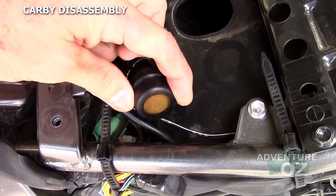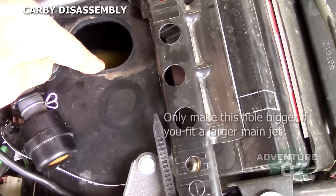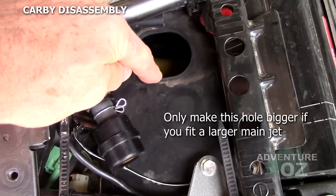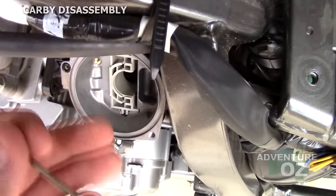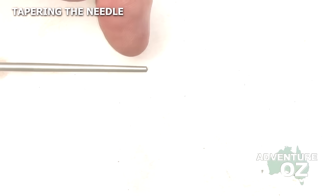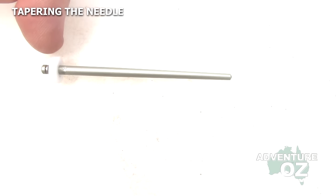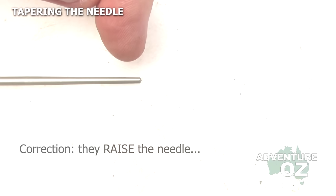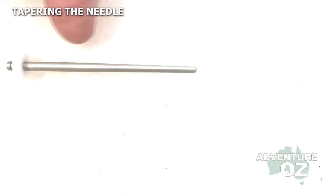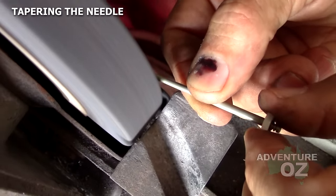If you taper the needle, what you can do is take your snorkel out but don't enlarge the air hole. You'll get increased air intake, but just enough to suit a tapered needle — assuming you don't change your main jet. The problem with the stock needle is it's too fat down here, so the bike is too lean off idle. A lot of guys drop the needle to get rid of that bog off idle, but then it's crap everywhere else through the rest of the rev range. What we're going to do is taper the needle to get good fuel-air mixture right through the rev range.